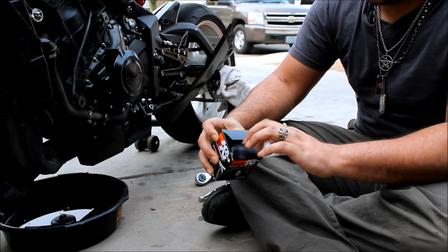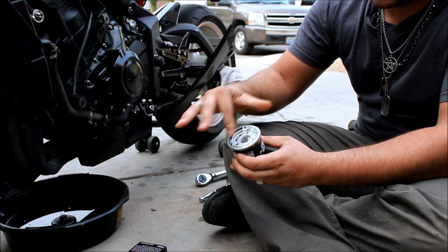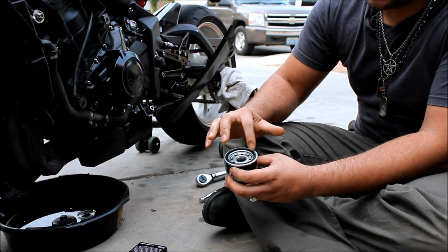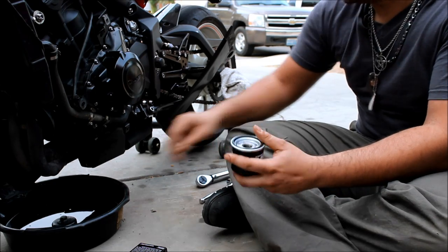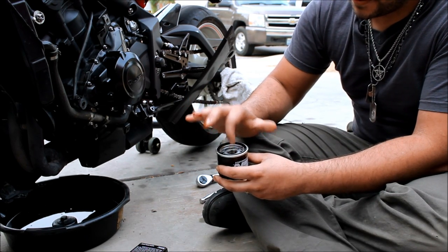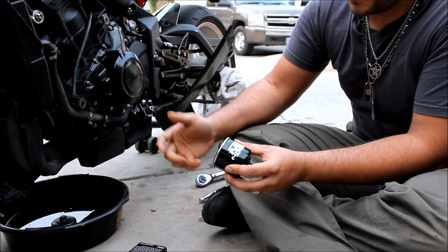So now we're going to get the new oil filter and ensure that the new oil filter is the same type as the one that you removed or the one that is factory spec. This one, K&N specifically, has this little guard over it — we'll take that off. You're going to want to take some oil and go around the lip of this filter. The reason we do this is that it creates a better seal, and then when you tighten this down, you'll actually be able to tighten it down a bit further than you would if this was creating friction. So just get a little bit of oil, either new or used, it doesn't matter, and just go around the rim. Some people like to actually fill this up, but really that's personal preference. People say that it helps to prevent dry starts, but the way this is mounted it's sideways and all the oil is just going to spill out, so it's really a personal preference at that point.